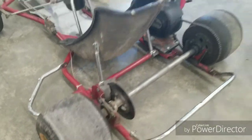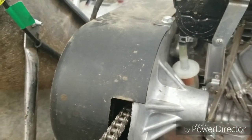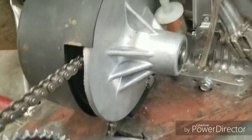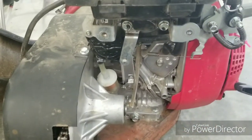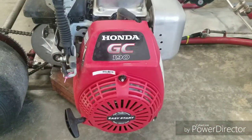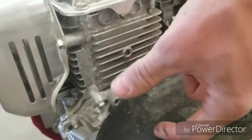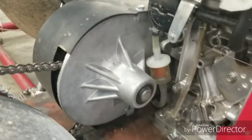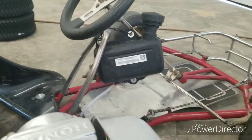This thing's actually rock solid — I'm super stoked. It just amounts to the engine, and then it has a solid plate here with a bearing for the jackshaft essentially. It doesn't work with the standard GX engines that everybody loves to use, which from my research are a little more solid and robust than the GC series. The GC has a completely vertical piston, which is what you need, because the GX pistons run back on an angle and that interferes with the jackshaft down there. As you can see, it's already quite tight. I just took the fuel tank off and mounted it up there with some zip ties — whatever works, just fine.